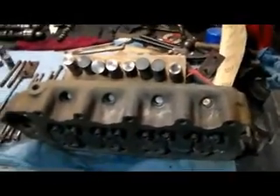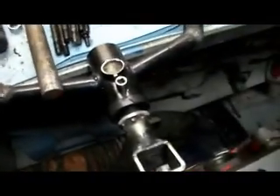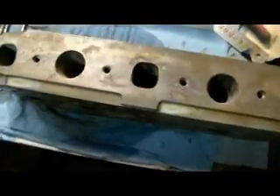Okay guys, this is the last bit - the next sort of section. The engine's nearly there. Just got to fit the ancillaries. The cam followers are in - I forgot to film putting them in, but they're basically only buckets so nothing exciting there. There's quite a bit of sealant that'll be in between. Just a matter of getting the head ready. The head's ready for a bit of work - it's clean apart from needing a bit of a cleanup, and it's going to get some mild porting.